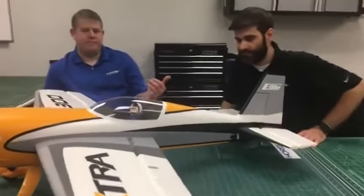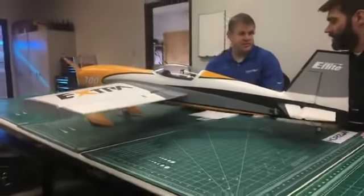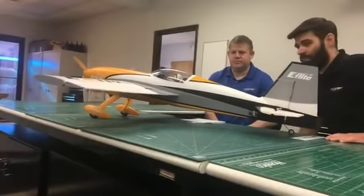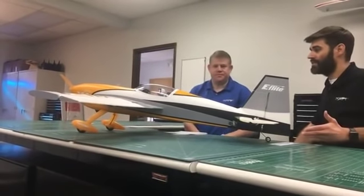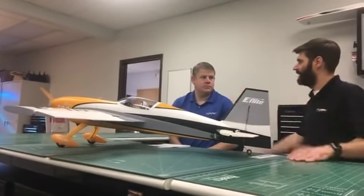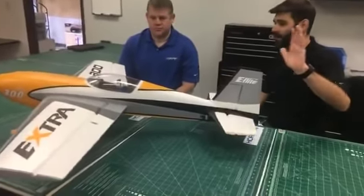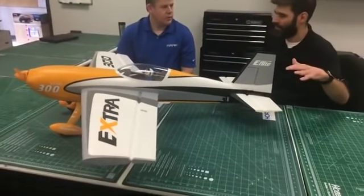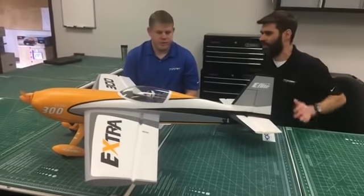So you talk about batteries. Is it 3S and 4S? Exactly. And what's the range of it? So like a lot of our recent E-flite releases, we're making the airplanes 3S and 4S compatible whenever we can. On 3S, it can run anywhere from a 2200 up to probably even a 5000 would fit in there in CG okay. And so with 3S, it's got very good power. It'll hang on the prop, close to full throttle, or you get a little bit of headroom depending on how good your battery is, and you can punch out and climb vertically on a 3S.